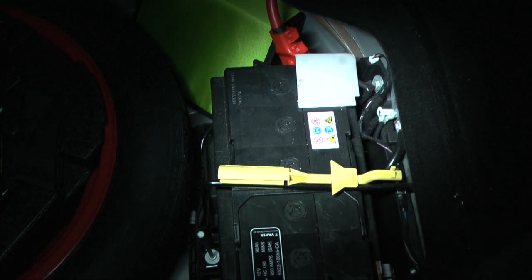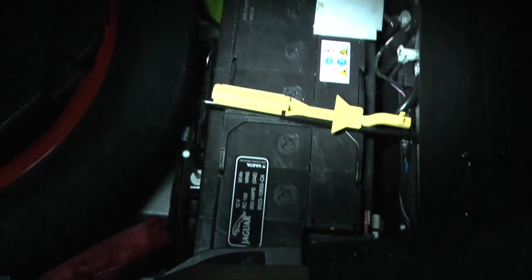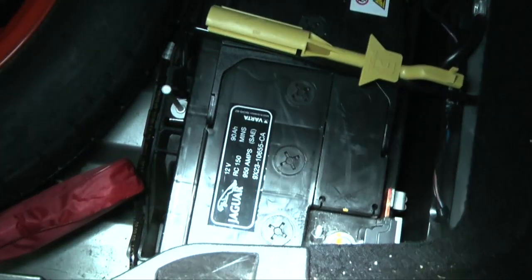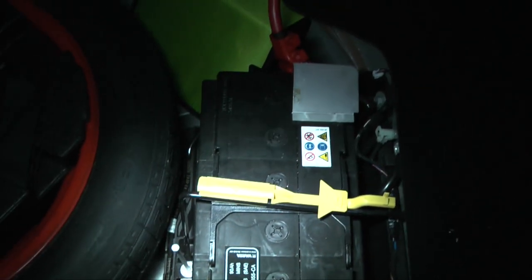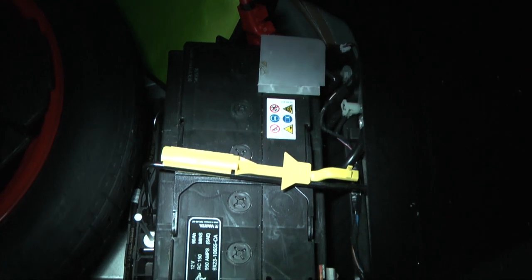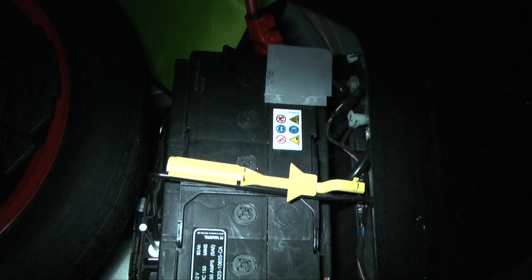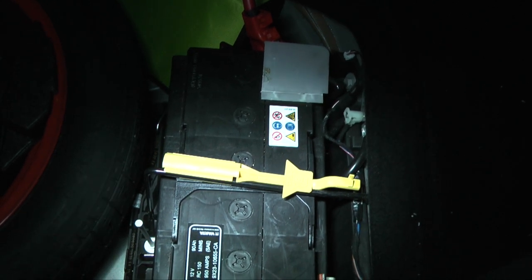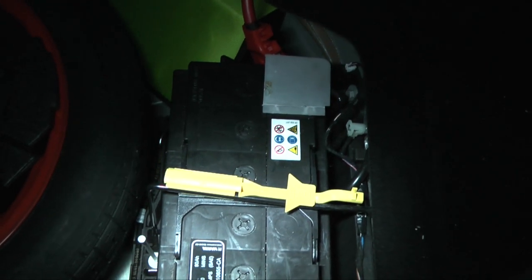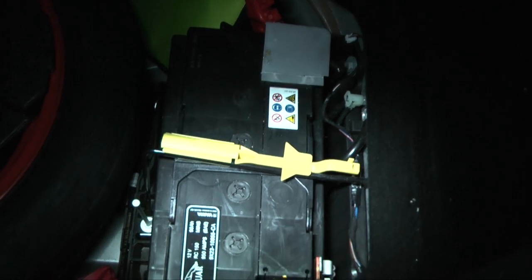After any work on the rear rotors or pads you'll need to reset the electronic park brake. You can do it through diagnostic software, or simply disconnect the negative battery terminal for 30 seconds and reconnect it — you'll need to reset your electric windows and so on, but then just follow the dashboard instructions: pump the foot brake to apply the pads to the disc, then apply and release the park brake as instructed. That completes the job.